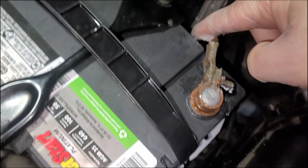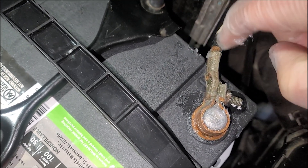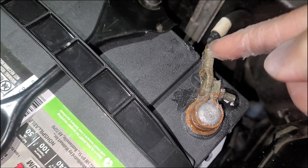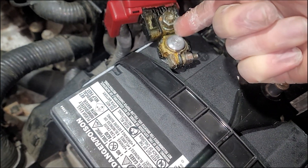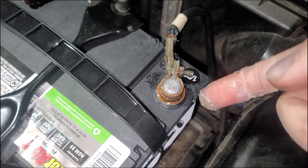Just a little bit over the important exposed bits. Same thing with this here. There are electric sheathings that do a little more insulation, but a little bit of grease works. Same thing on your positive side — this already has a little bit of old dielectric grease, but a nice little fresh coat for the winter.